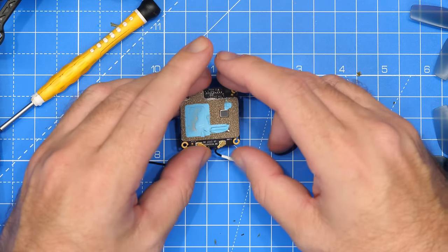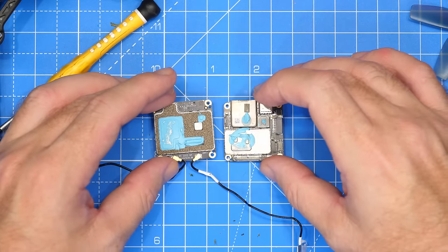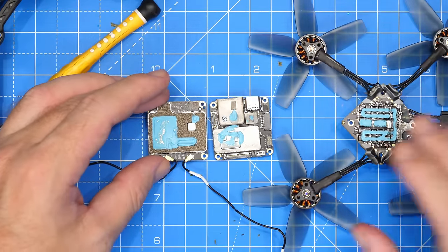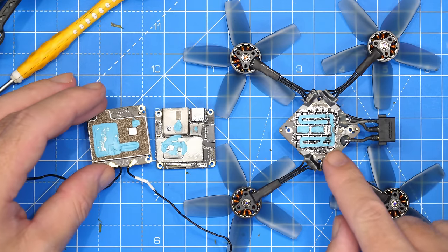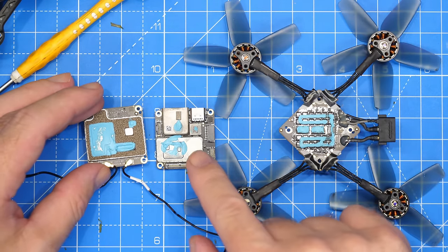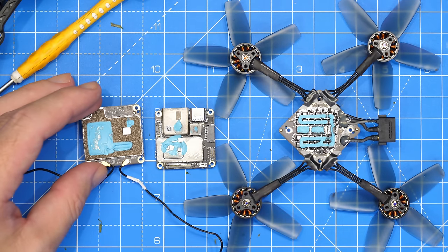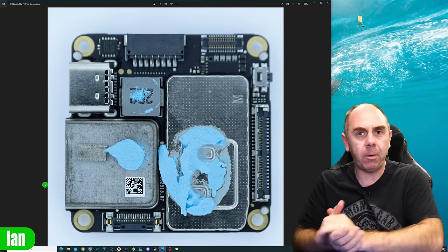What is clear is DJI have very much designed this drone all the way from the bottom up to be user repairable — everything is modular. That is our main OcuSync RF board, two sides to it. So looking at the boards in the Avata, you've got basically three PCBs: main power and ESC, SD recording and image processing, and then RF on this board here.